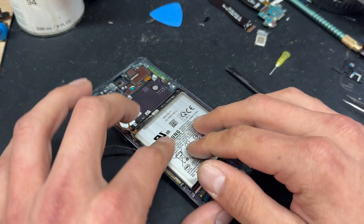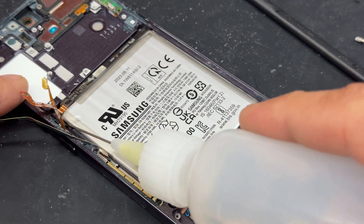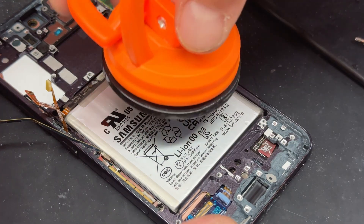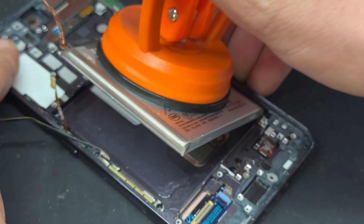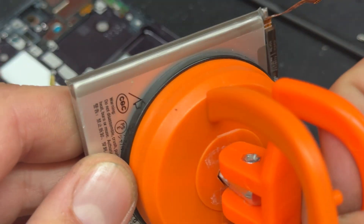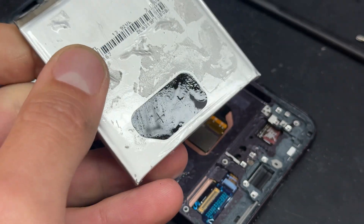The final part of the puzzle is the battery in the middle. The easiest way to remove it is to soak either side of the battery with some isopropyl alcohol, let that soak in for a good five minutes, and then use the suction cup to stick onto the battery and pull it out. They've used poor quality adhesive on this one — you will find it's a lot more difficult than that to remove normally. I believe this is a reconditioned phone and some substandard adhesives have been used.